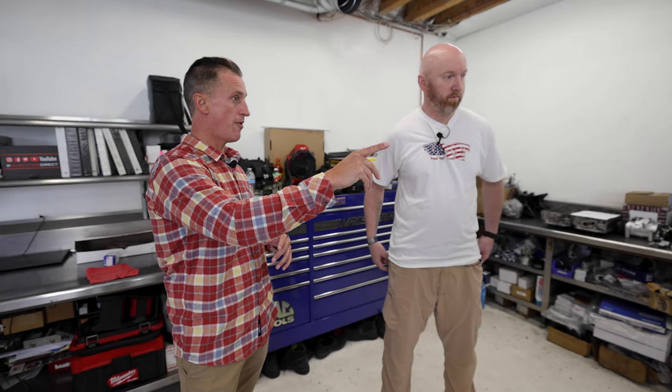When we build a Duramax engine from the ground up, it's assembled in here, and then it goes on the engine dyno. We have a program on there that goes through the break-in procedure. You actually just hit run and it brings the RPM up and down and up and down, oscillating it. It runs for about half an hour or so. We put varying degrees of load on the engine, so that properly and scientifically, that's a big word for me, breaks in the engine.